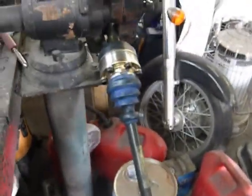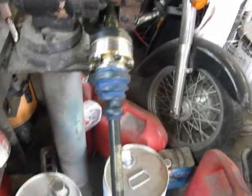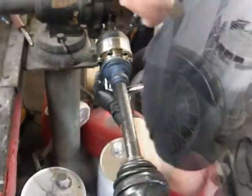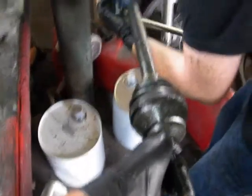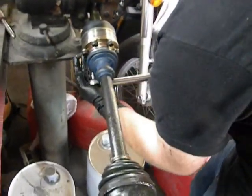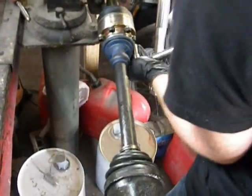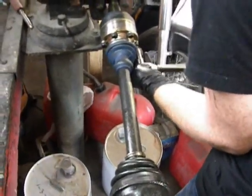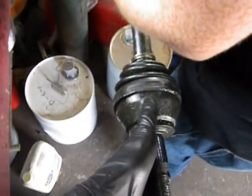It says 57. That really feels like quite a lot. And one of these washers actually popped out trying to get it to 57, so we're doing it down at 52, and we think that'll be fine. And this is the other axle. On the one before this, we did the torque at a good solid 55. That seems to be a good point. And we're not having any trouble getting it to 55. Nice, good torque figure. We've already greased the inside of the CV.